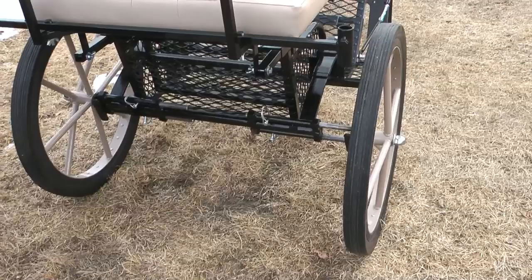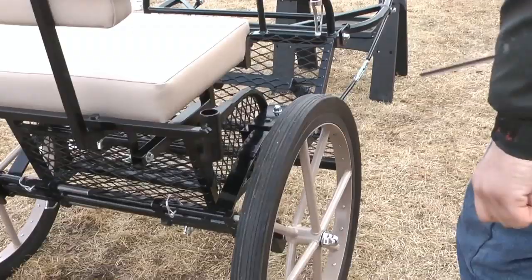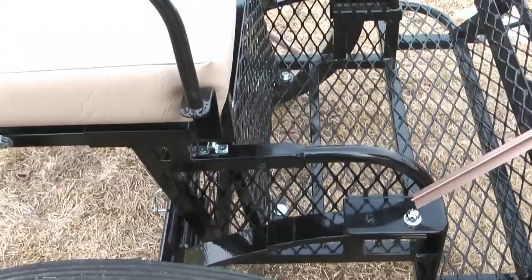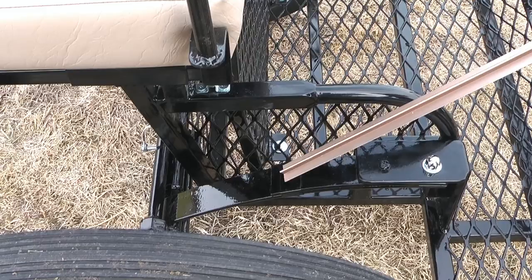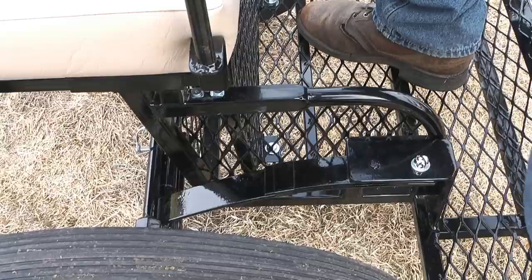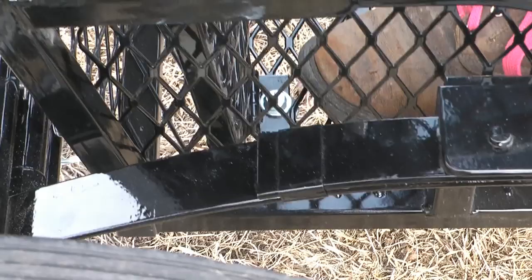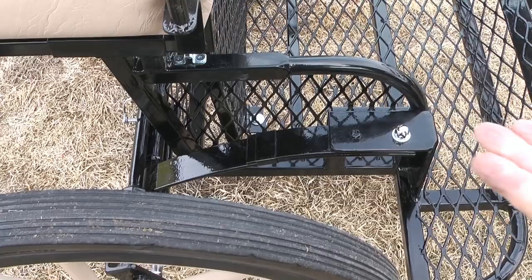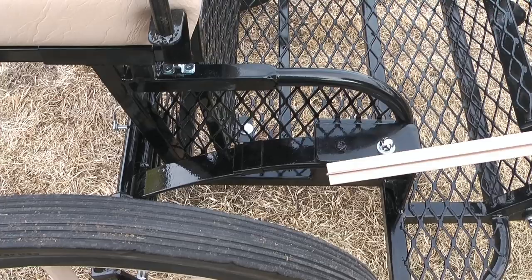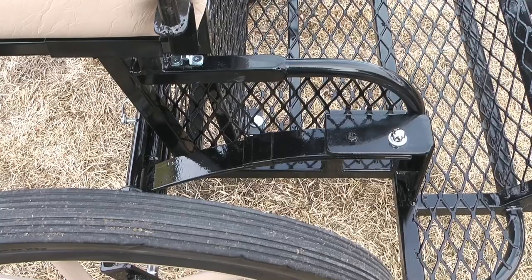Now I'll outline briefly how the suspension on this cart works. It's called a quarter elliptical spring suspension — I have half of a full elliptical leaf spring here. This is set for a particular length, bottom leaf and top leaf, to carry the weight requirements for this cart. As the cart goes over rough terrain, the wheel will go up and back, using both motions to absorb the energy of hitting bumps, resulting in a very smooth ride. All our customers with the cricket carts have been very happy with how they ride.